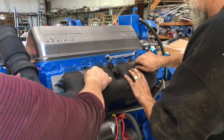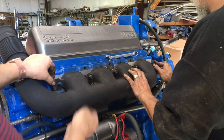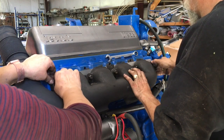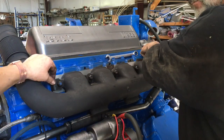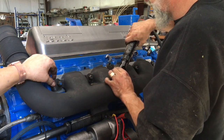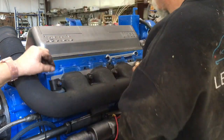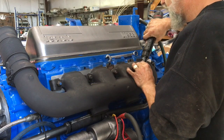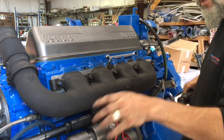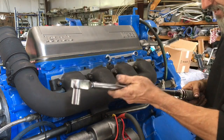We're resting on the ledge. It's not going to go anywhere — I don't have to worry about that. I'm going to use our handy battery-powered ratchet, just get it close. Another thing you want to do is also measure your exhaust manifold to make sure that it's straight before putting it on.